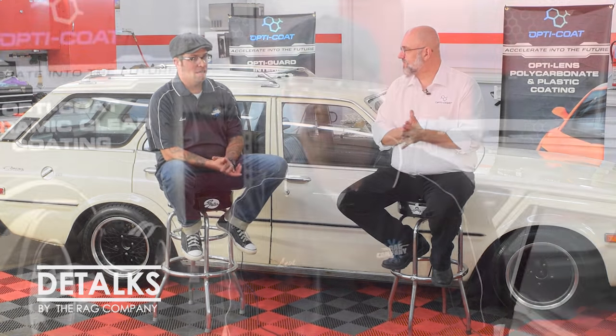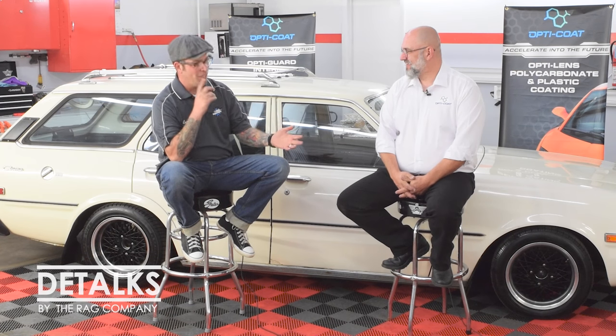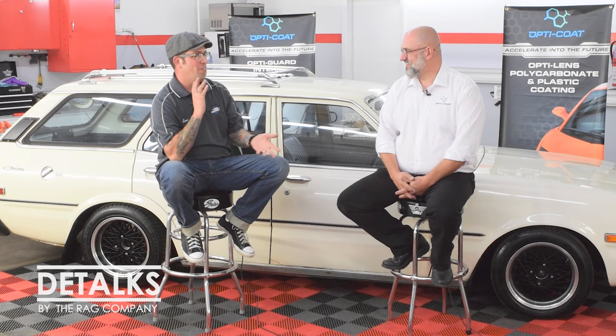Well, I had a guy at a car show this week who said, oh yeah, I cranked my buffer up to six. And he polished it out, and then he went and bought a t-shirt to cover the quarter panel of his car because he heated up the clear coat so much that when the sun hit it, it had shrunk back down, and you could see every single wet sanding mark he had left in it. You could see swirl marks up and down, buffer trails all over it, and he was like, I'll probably just have to bring it into you guys and have you fix it all for me.